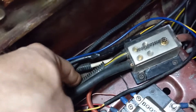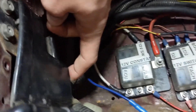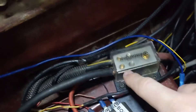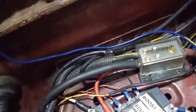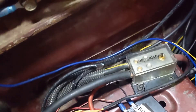Now for the voltage gauge, I just have this white wire — it's stock — you see it traces back up to here from the wiring harness, and then it goes into my battery power. That will give you the 14-volt reading, like the voltage gauge and all that, so that's super easy.